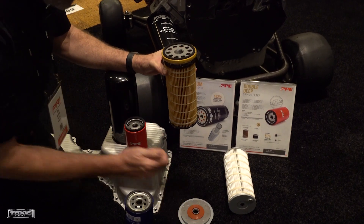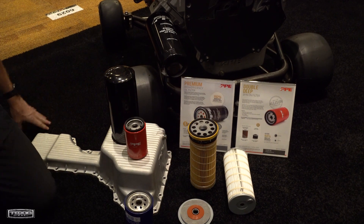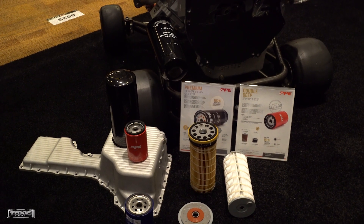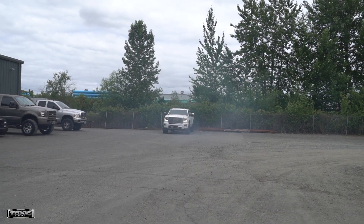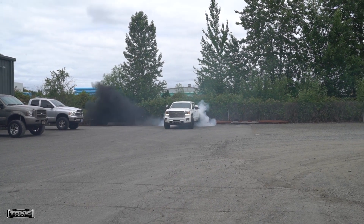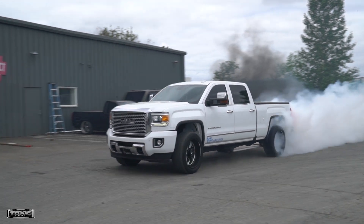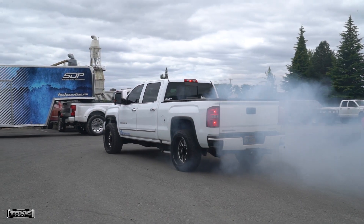That's one of the biggest things that people aren't aware of when they buy that CAT filter. So you're telling me it's going to cause a dry start? Exactly — pretty much every time you turn your motor off, depending on the duration of time it's off, the longer you let it sit, the higher the chance of metal-to-metal contact when you start your motor, until the oil pump can fill all of that volume back up in the motor.